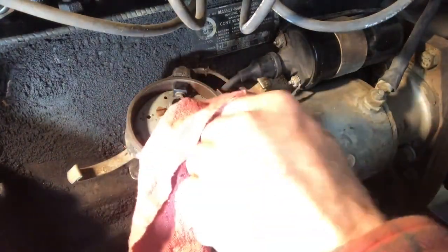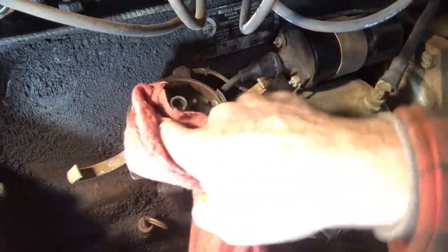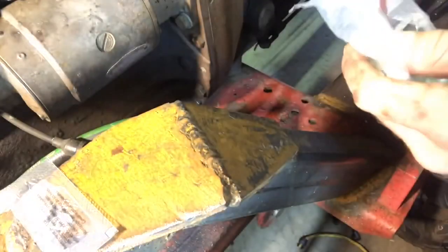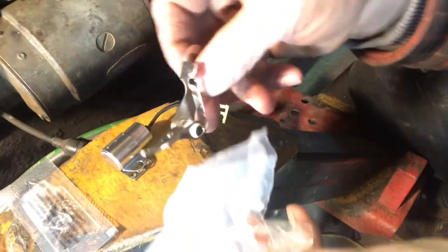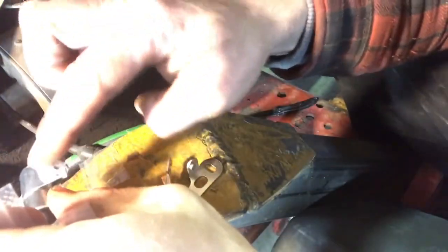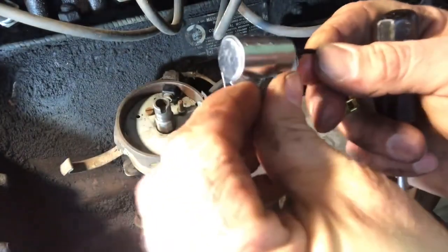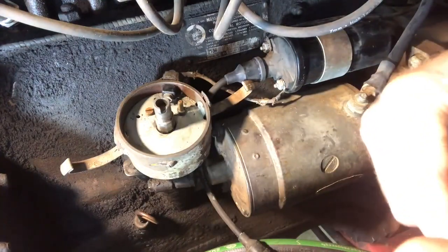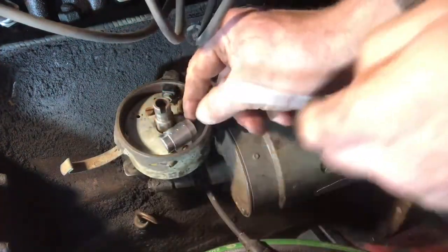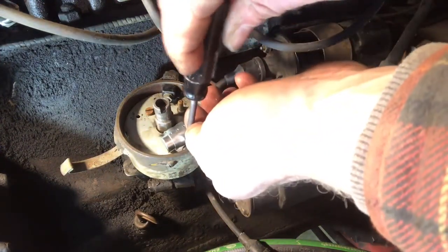I am going to clean up the surface. You want a nice clean surface where your points go on so you can have a really good ground to the base plate. We open the bag up, I've got my rotor — I'll set that in a safe place. Here is the capacitor and the points. I like putting a bit of dielectric grease right on the clamp. The reason for dielectric grease is so it can't corrode and have a bad connection. The screw is started, the condenser is centered, it's not rubbing on anything, and we are going to tighten it up.